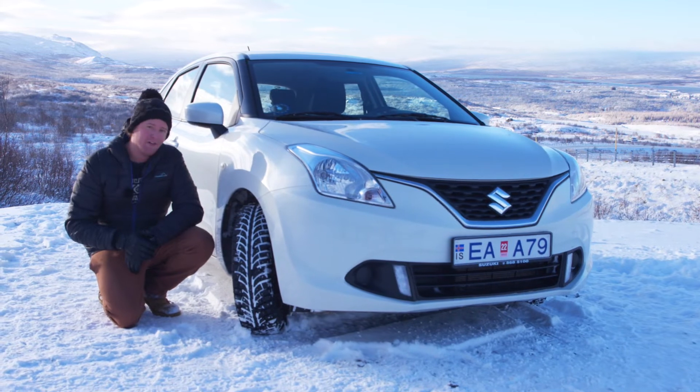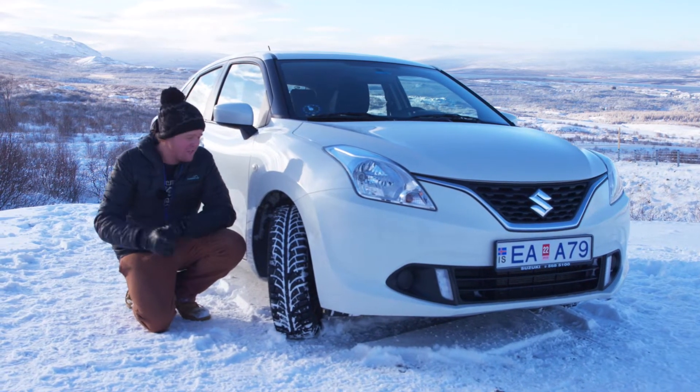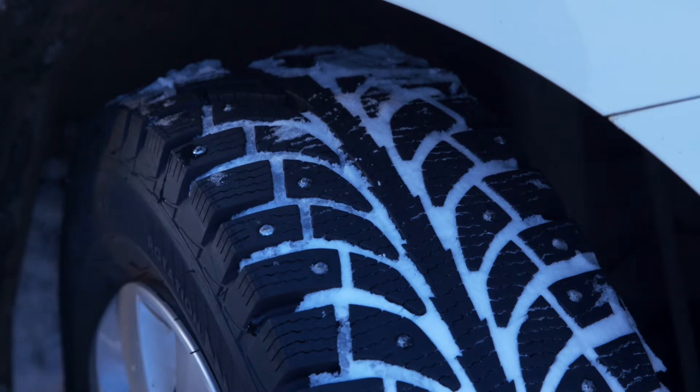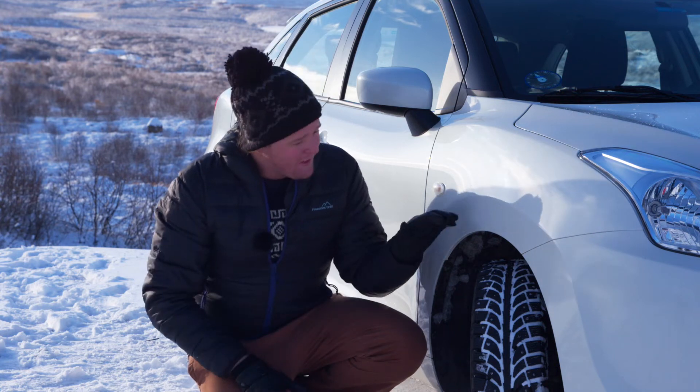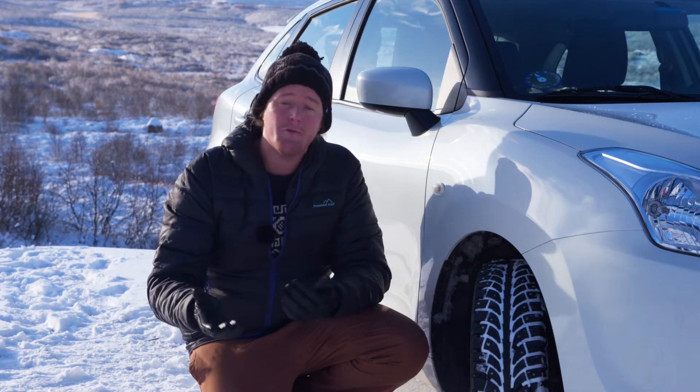This is a winter tyre, and it's a little bit different to the summer tyres you might be familiar with. The first thing is it's got studs designed to hook into compacted ice and snow on the ground. Not every winter tyre has these, but what they will have are these zigzag lines called sipes and deep tread designed to trap snow. The snow that gets stuck in here actually grips more snow on the ground, so you get better grip.